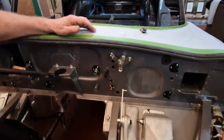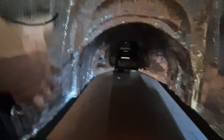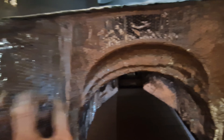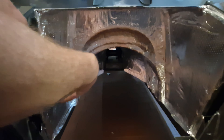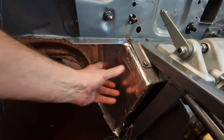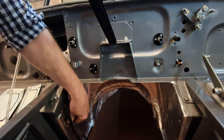From the bulkhead side, what we have done is a heat insulation. Usually the 2+2 has a panel which is bent all around and mounted to the floor — you can't get that panel anymore. So I used what I've used on my other cars: a great insulation material. It does a really good job getting the gearbox tunnel completely covered on the outside, to keep the heat out and not letting it go through to the metal. My belief is that keeping the heat outside is better than letting it reach the metal and spread via the metal sheets all over the interior.